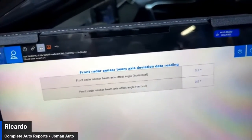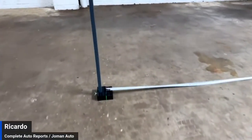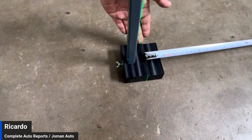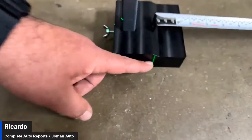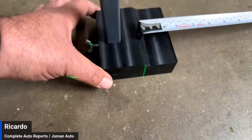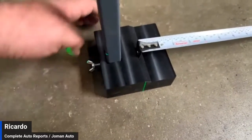So now we have positive 0.1 and 0.0, and I just want to check to see how crooked we are. I'm going to lift up this line — and I don't know how visible it is on camera, but it is clearly visible in person that this is crooked. There is the ending point at the top of that peak, and the starting point is a solid two millimeters before this peak, which means this target is actually biased to the driver's side. To adjust it, we would turn it slightly to make it more perpendicular to the car.